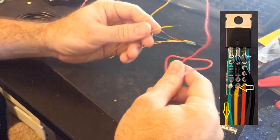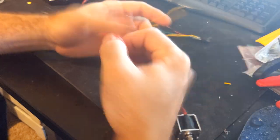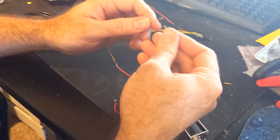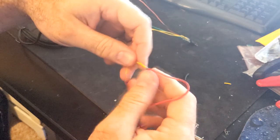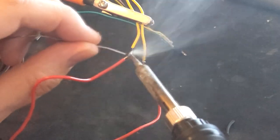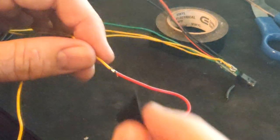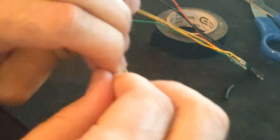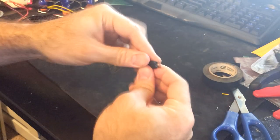Either use tube shrink wrap or electrical tape on both wires. Now it's time to wire your solenoid. For my wire combinations, my two yellow wires — twist each wire together; it doesn't matter which one goes to each other. Solder both wires and then wrap in shrink tubing or electrical tape. Make sure to wrap everything together either with electrical tape or shrink tubing.